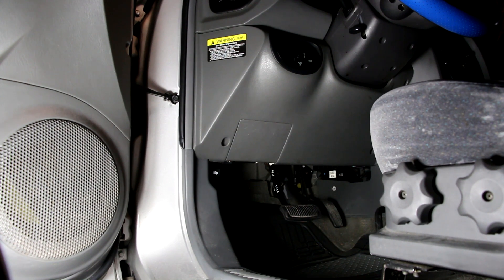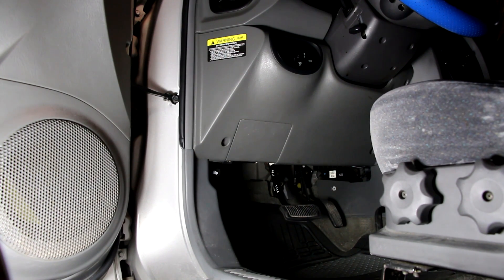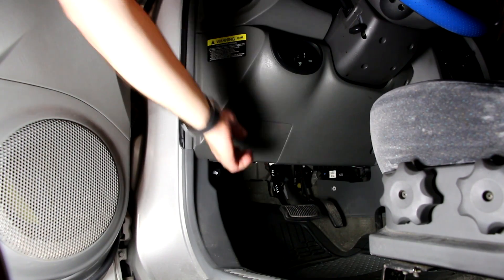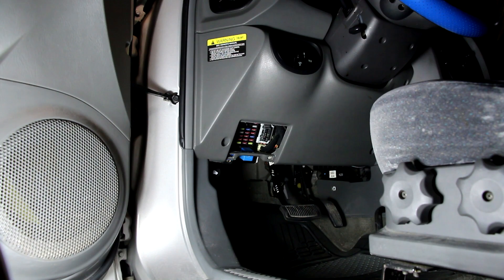I'm going to plug this into the car and show you how to make the tablet talk to the OBD2 adapter. On the Hyundai Santa Fe 2003, the OBD2 connector is actually beside the fuse box. You'll have to remove the fuse box panel — all you need to do is pull on the bottom of the fuse panel cover and off it comes. Your OBD2 connector could be anywhere depending on your vehicle — it could be under the dash, behind the glove box, or even in the console. If you can't find it, just Google your car and OBD2 connector.